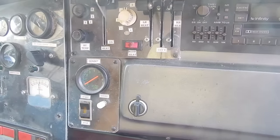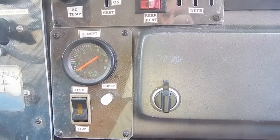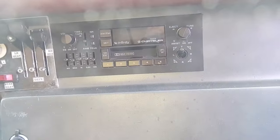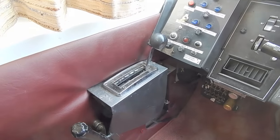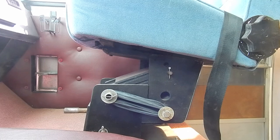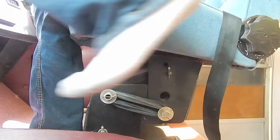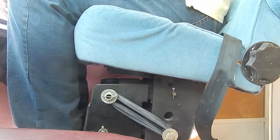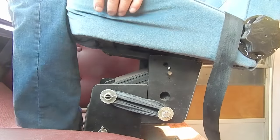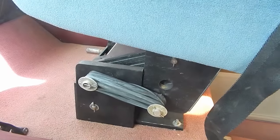To the right again is the heating and air conditioning control panel, the Genset start/stop tachometer panel, and AM/FM radio. Just below my left hand is the gear shift and the parking brake lever. Mrs. Holmgren found the ride right over the steering axle to be a little less than comfortable, so recognizing that truckers swear by their Bostrom seats, I made up a seat suspension system for the passenger seat — just parallel linkages with bicycle tube for spring. The rubber spring works very well and doesn't bounce back, so there seems to be no need for a recoil snubber.